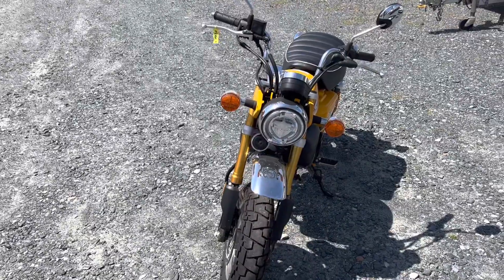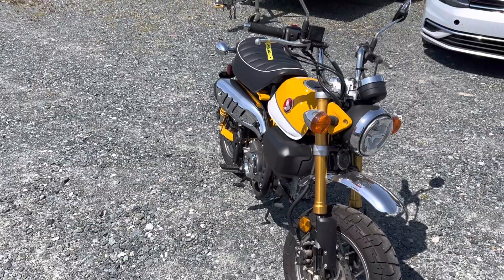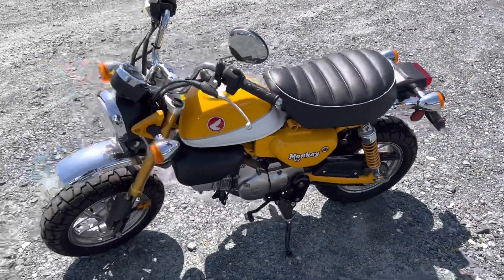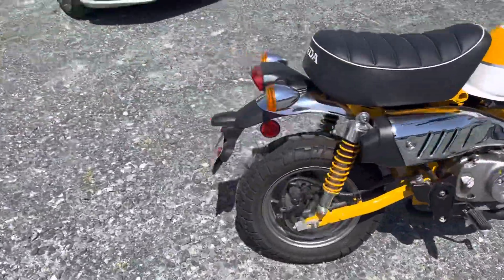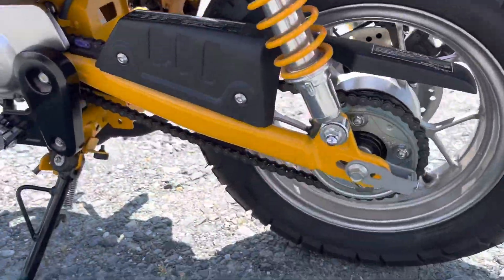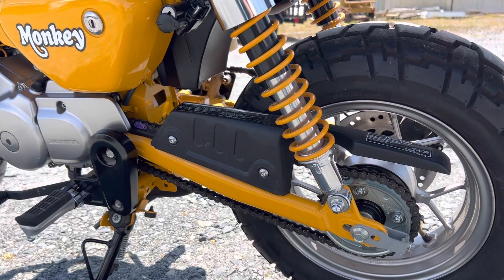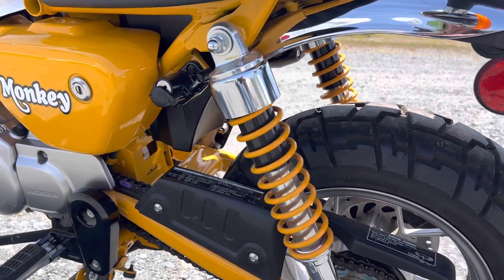It has a 10-to-1 compression ratio, so pretty decent power out of a little motor. It is five-speed, which is a pretty cool benefit — they could have easily done a four-speed, but that fifth gear is going to give you a much better top speed and much lower RPM at the higher gear. You do have a chain drive, so that's going to be pretty lightweight. Looks like maybe a 428-size chain — pretty small. You're going to need to maintain that every 500 to 600 miles: clean, lube, adjust.